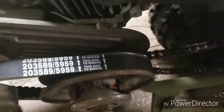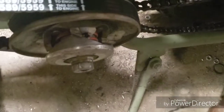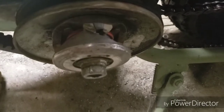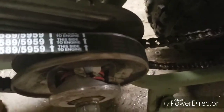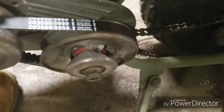Now when you put them in, make sure that you have the keyed 5/8 inch washer back behind, between the plate back there and the sprocket, because your quarter-inch key goes into that washer, and it rides up on the bearing hub. Out here goes the non-keyed washer for the 5/8 shaft, and I usually put them on there with about 35 to 40 pounds of torque, and that's it. You don't want to over torque it, because if you do, you're going to break that clip back there and you're going to yank the shaft out. And it really doesn't need that much because the key holds it.